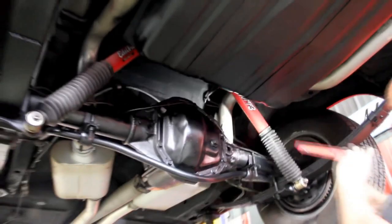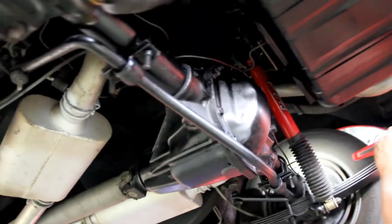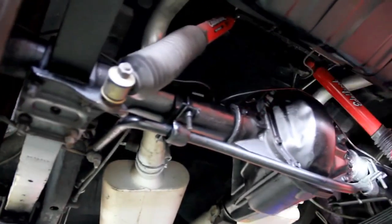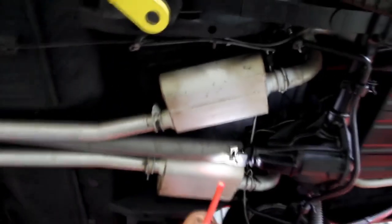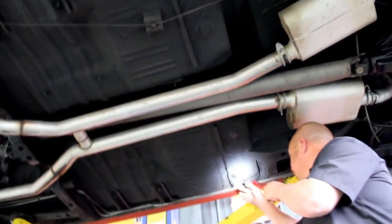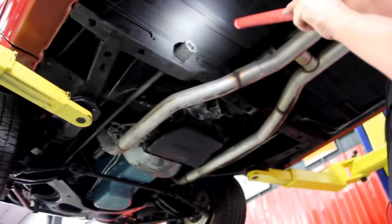We're underneath the car now — she's nice and solid, all factory undercoated. No evidence that it's ever been rusty back here. Good looking tank, Flowmaster exhaust, looks like brand new Edelbrock shocks. We've got a Dana 60 with a Sure-Grip in it, 3.54 gear. Looks like the brake lines and parking brake cable have been replaced. The floor boards up front are all gorgeous, with new fuel lines running front to back — all nice and solid. You can tell this car was just well taken care of.